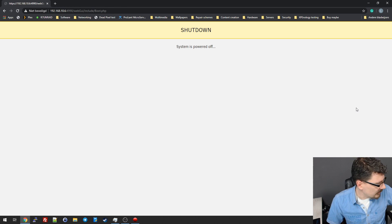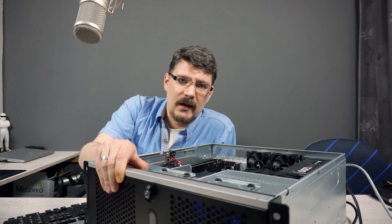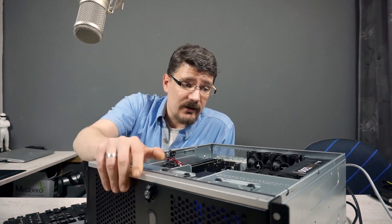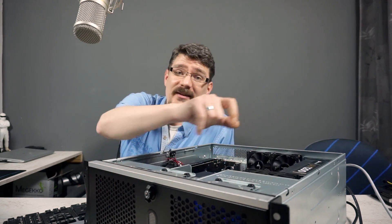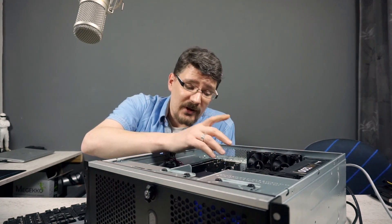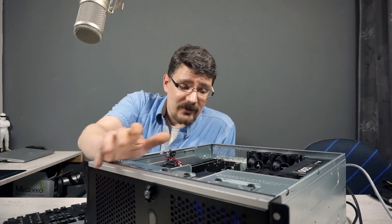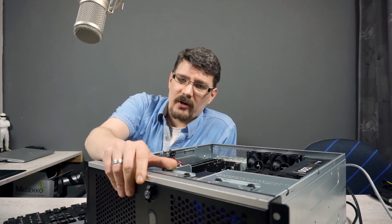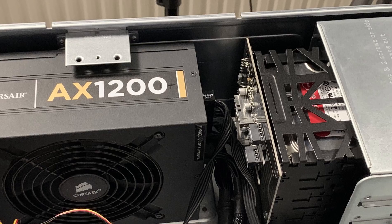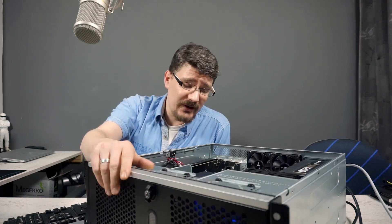Let's talk about the build process. Building this beast was not exactly quick. I started with the ICY Dock, then the PSU. When I went to install the motherboard, I found out the ICY Dock was in the way — it was installed exactly over the RAM modules and a piece of the motherboard. So I took the power supply out, then the ICY Dock, then installed the motherboard. Moved the RAM modules from A0 and B0 to A1 and B1. It was a bit of a puzzle. This is a very compact chassis, and that didn't make things easier — especially with a big power supply, the ICY Dock, a big graphics card, and a couple of hard drives.